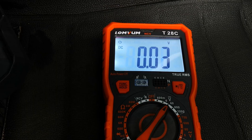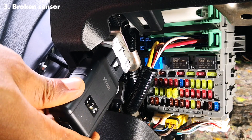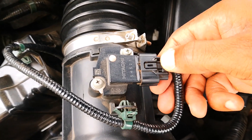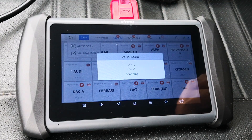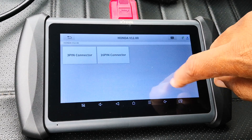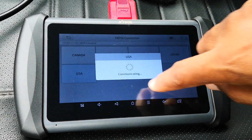The third cause is often annoying to troubleshoot — it's a broken sensor on the car which has effectively shorted the communication between the port and the ECU. For this, you have to disconnect sensors one after the other. If you disconnect a sensor and communication returns, that's your problem sensor — you will need to replace it. While this can be time consuming, you can always start from any sensors that you had codes for before you lost communication with the vehicle.